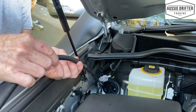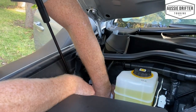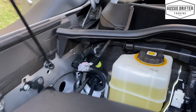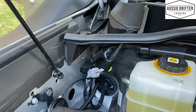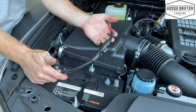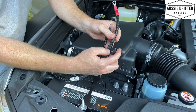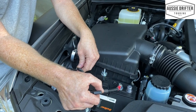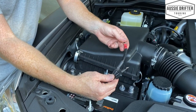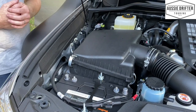On the end of this cable we've got our sleeving with a bit of heat shrink, and that heat shrink is designed to go right into that hole and plug it up, giving us a good watertight seal. We've got enough sleeving to go through the engine bay and get us up to our auxiliary battery. We're not going to make this connection yet — connecting to the battery is definitely the last thing we want to do. You'll notice the harness is labelled 12 volt sockets but there's no fuse in it at the moment. The last thing we're going to do is make the electrical connection and insert our fuse. For now we just leave this sitting in the battery bay and continue to route our cable towards the back of the vehicle.